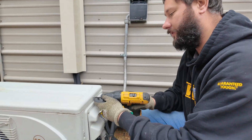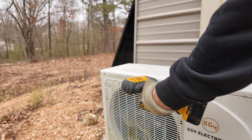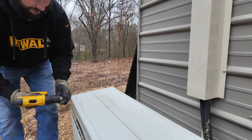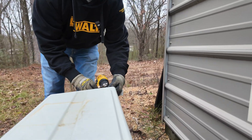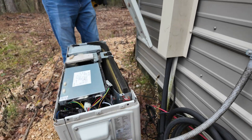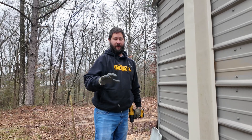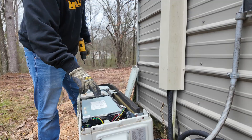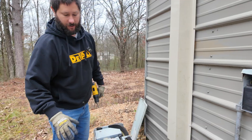We're going to take off the top panel first. We just have Phillips screws that hold that panel in place. Make sure you keep the screws so you can put them back when you reassemble the mini-split. Also, you want to wait at least 15 minutes before taking this apart so you don't have any residual voltage, because the inverter board has a capacitor bank that needs to trickle down that power.